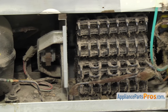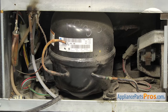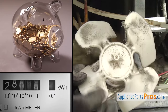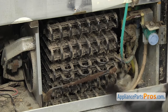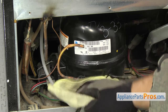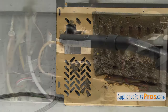Now, here's that money-saving tip we mentioned earlier. If your freezer compartment isn't getting as cold as it used to and your ice cream is getting soft, it could be that your condenser coils are dirty. Dirty coils can cause the freezer to run warmer than normal if the condenser and other components are covered in dust and pet hair, which insulates the coils and prevents them from working efficiently. This can also make the refrigerator run more and cause wear and tear. Keeping the coils clean can improve your refrigerator's efficiency by 30%, saving you money on your electric bill and future repair costs. To clean them, pull the refrigerator out and remove the rear access panel, then carefully clean the coils — some may be accessed from the front. You may need a condenser cleaning brush to reach in there. Also clean the compressor, condenser motor and fan blade, and wipe down everything else. Be sure you're careful not to damage anything, and do this at least once a year.